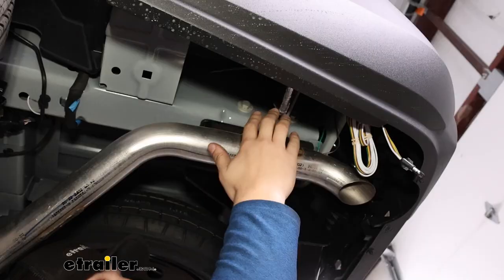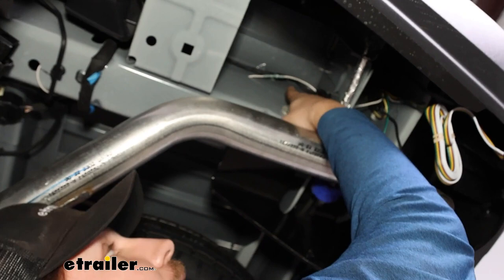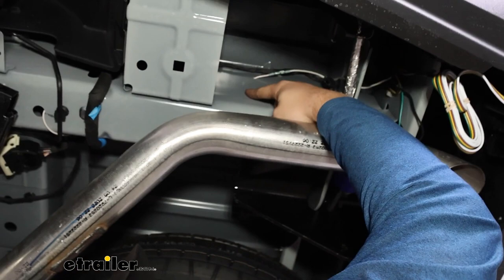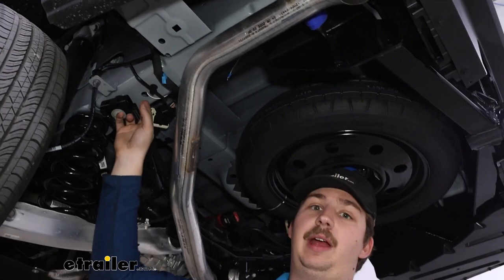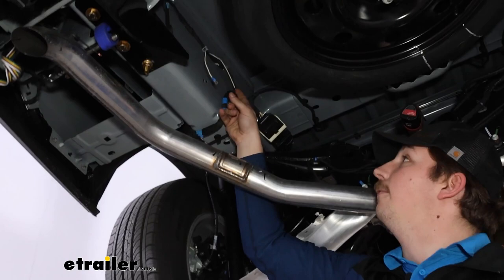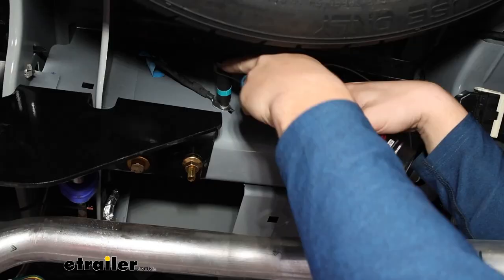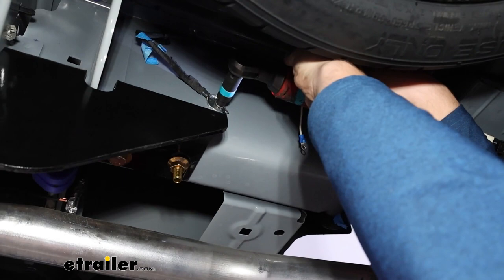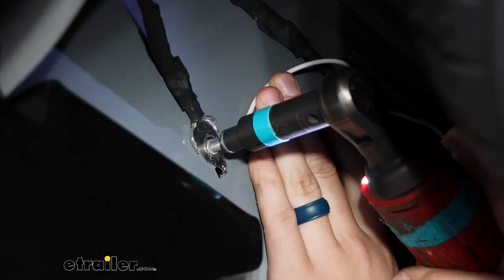From our black box, we ran the ground wire straight up — you can see where it pops out right here through a small hole between the sheet metal. You can see where our splice was with that heat shrink connector, and it runs into the frame nearby. Moving back along the frame, there's a large hole right near the tire where it popped out. I just kept feeding it in and pulled it out with a pair of needle-nose pliers once I saw it. From there it runs straight up, following some existing wiring, all the way to our factory ground. I've already cut and added a new ring terminal, so now all we need to do is add it to that ground. Remove the ground bolt, make sure we grab that bolt, add our ring terminal on, and then run it back down.